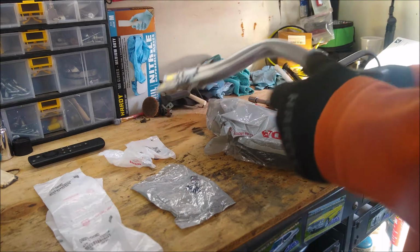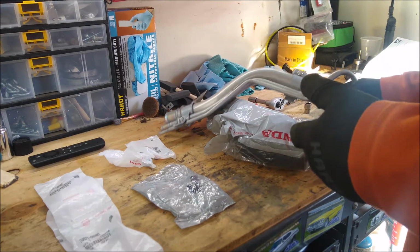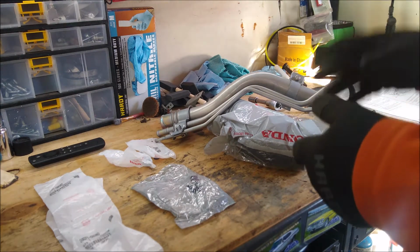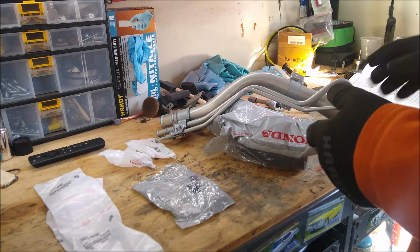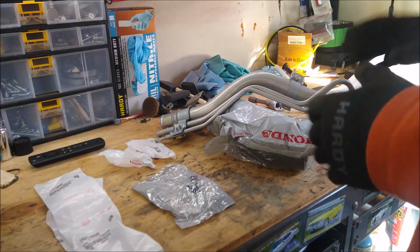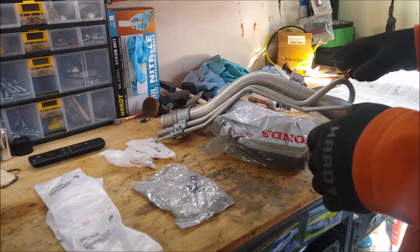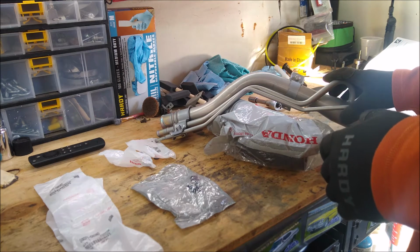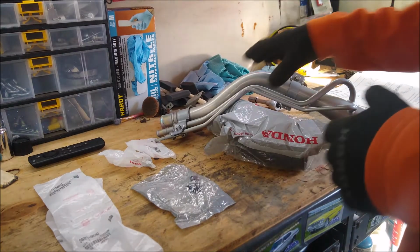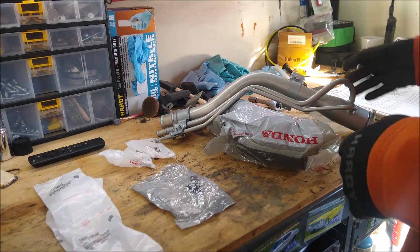What's interesting about this fuel filler neck is that there are no directions that I can find on how to replace this, so this will be very interesting. There's one picture in the Acura service book that talks about this process a little bit, and it's under the 11-190 page, which is the fuel supply system, and it's actually within the fuel tank replacement, where it talks about removing a plastic cover to access this. There's some bolts to remove, and then the hose clamps, obviously.